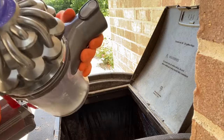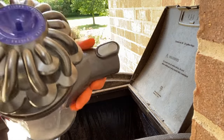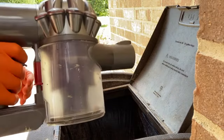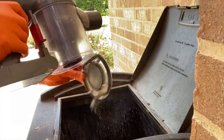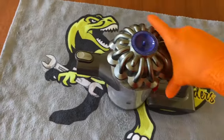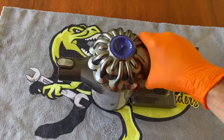Next, grab your vacuum cleaner and canister, rest your filter or screen portion down inside the canister, realign that little tab right there in its slot, and it should click right into place. Go ahead and test it. And that is firmly secured. Go ahead and push the red push button once, and any additional debris will come out that cap. Back inside, and again, we've cleaned the inlet. We've cleaned the entire canister or chamber.